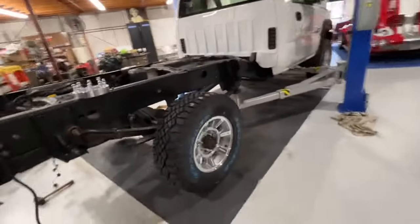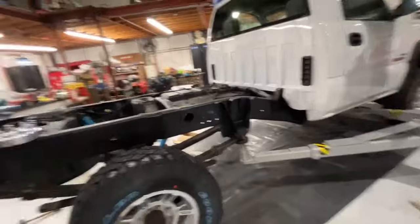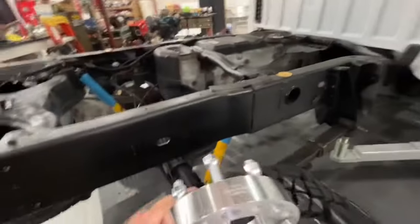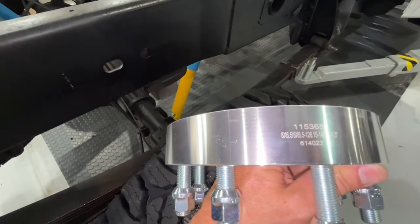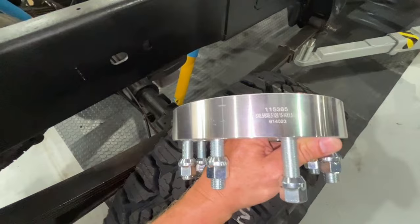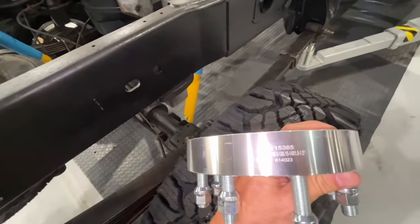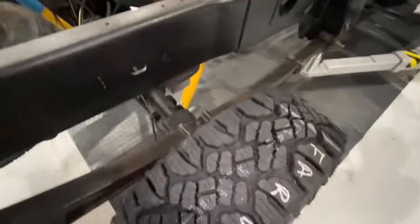Then you've got your wide H2 wheels with big tires — all GM, all factory stuff. The H2 is based on a 2500 Suburban platform, and this is a 2500 HD — basically the same wheel pattern. On the spacers, whether you've got a square body, a 90s 400 series, an 800 series, or even a 900 series, these are all the same — 8x6.5. So go with those inch and a half spacers. The factory spec is exactly three inches of difference between the front and the rear, which equates to an inch and a half on each side.